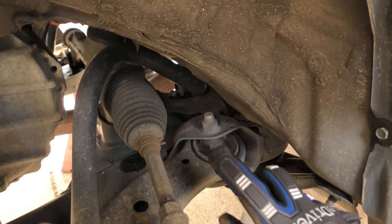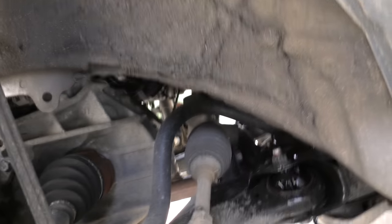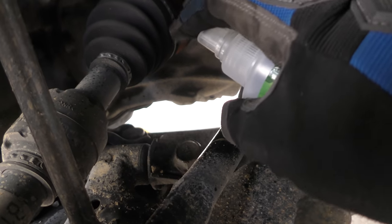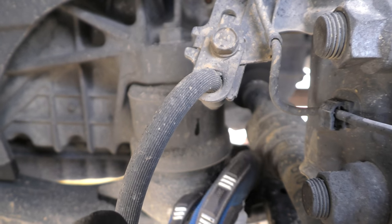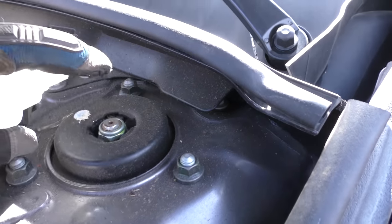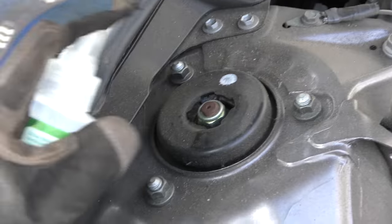So what we're going to do is spray all the rubber parts, and especially where there's any kinds of bushings — like down here in the middle right here, we're going to spray those. There's one side, you can't see it very well but there's another side too — we're going to spray that. Any place where there's a fulcrum, there's also one in here, we'll spray that. And just for kicks we'll spray the top — this is all rubber — and we'll do the same here and the strut mount here too.